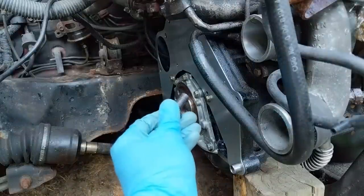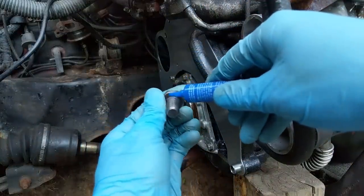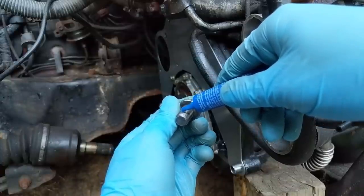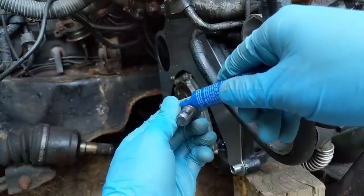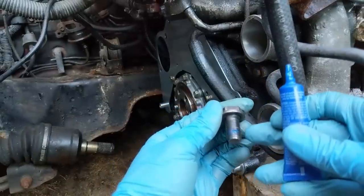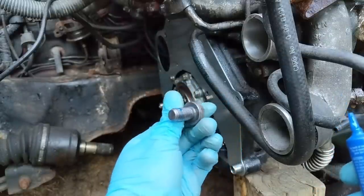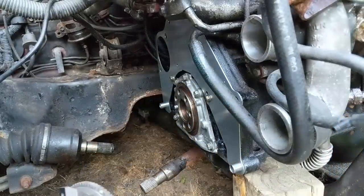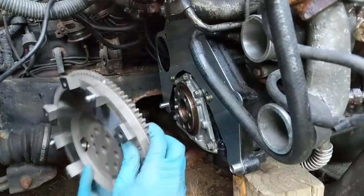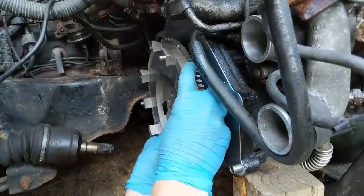Got a little Crisfix shot going here, but the instructions from Mitsubishi do say to use Loctite, so I'm just gonna use a little drop about 3/4 of the way down the threads. And they specify a specific type of 3M bolt locker, but I just have the blue stuff and it should work. And you don't need a ton, and only about the forward half of these threads actually goes into the crankshaft, so that's really where you need it. And obviously there is a hole that you have to match to the dowel on the crank, which should luckily also help hold it in place.